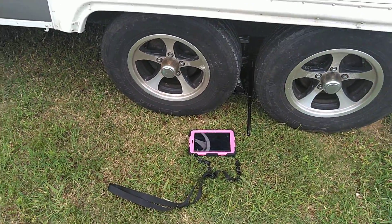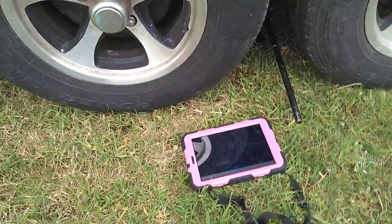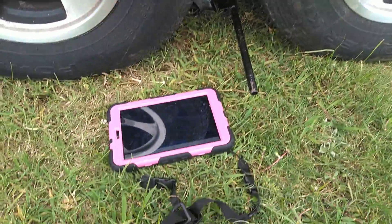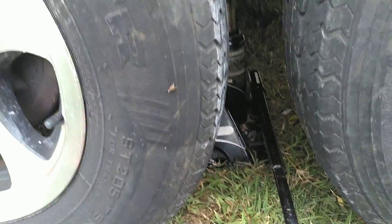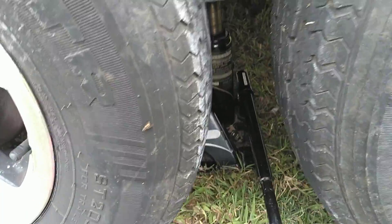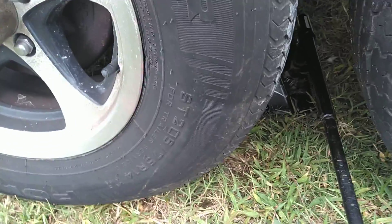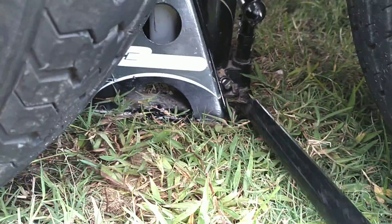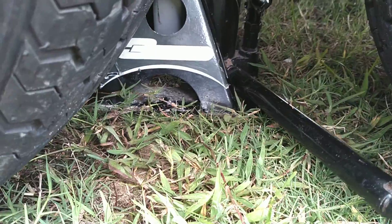The trailer tries to compensate so it should be fine at four inches or so. It's a long coach and only so accurate because it's not perfectly flat. Anyway, I have to perfectly position the jack right here between the tires, because that's the place where it should be lifted. You want to make sure the screw down here is tight — the end of this jack acts as a screwdriver. Tighten it, make sure it's tight.